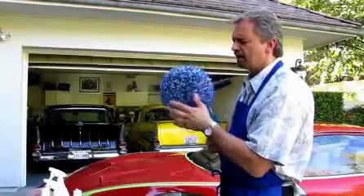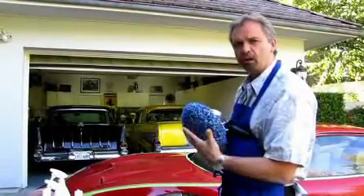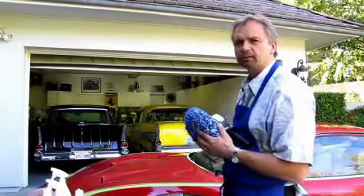It's just to keep the area clean, and when we buff for about half the hood or so, we'll come back over and clean the pad again to just keep the residual compound polish from getting built up on the hood.